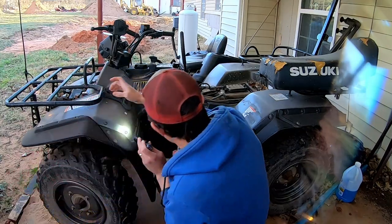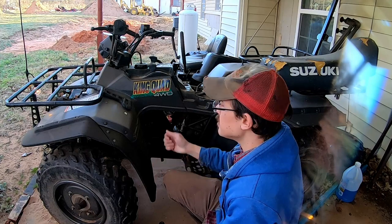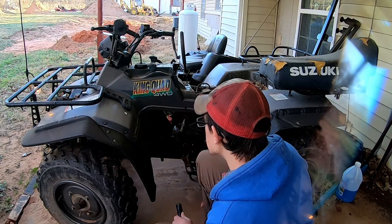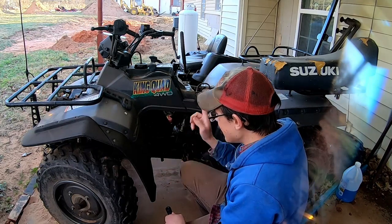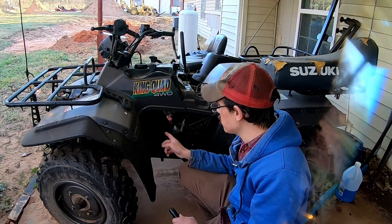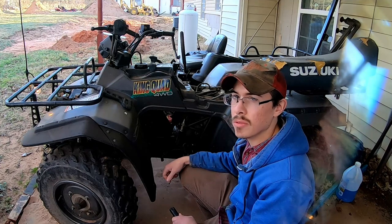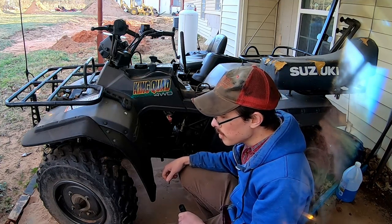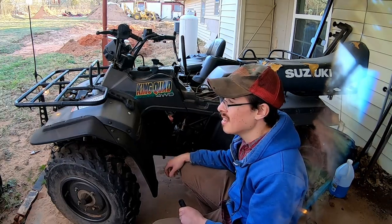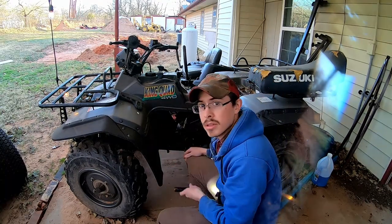Basically, I'm going to do a mixture of cranking it and seeing what happens, and disconnecting fuel lines and then cranking it to see if fuel will come out. I'll probably start at the petcock and work my way downstream. Another quick thing is there sometimes is a filter screen in the bottom of a petcock, and that could be clogged up also. So I've got that screen, and two other fuel filters, and hopefully it's one of those, because I don't really want to rebuild the fuel pump. Sometimes if the fuel pump goes bad, that can mean I might not have enough compression, which could be an engine rebuild, but I really don't think that's what's happened here. So anyway, maybe we'll just start going down the list.